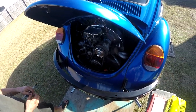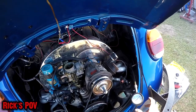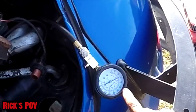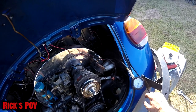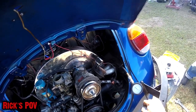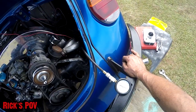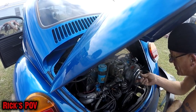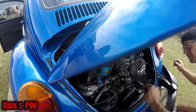There's no way we could have done a compression test before addressing the valves. Pat should be in tomorrow afternoon and we'll pull the motor. Checking compression now — number one cylinder: 125, 130. Got a noise in it — with all those missing bolts it sounds like it might be a lower end noise, maybe a wrist pin. Number two cylinder: 130. Everything is loose on this motor.